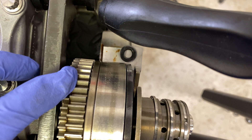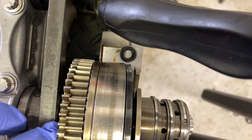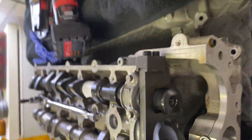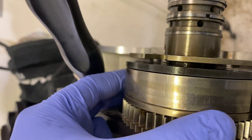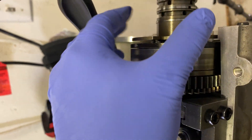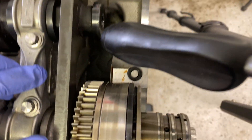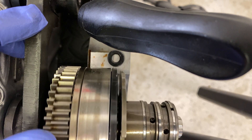At home, if you're doing this yourself in the garage or in the shop, assemble everything but take out the friction washer from the surface and don't install it. Put the adjuster in and tighten it so that it spins freely and there's no forward and backwards play, or very little of it. If there is play, you can tighten the bolt up front.